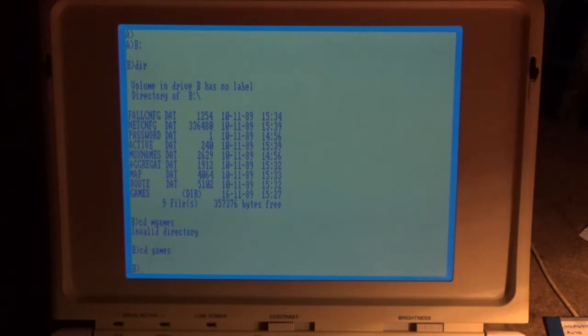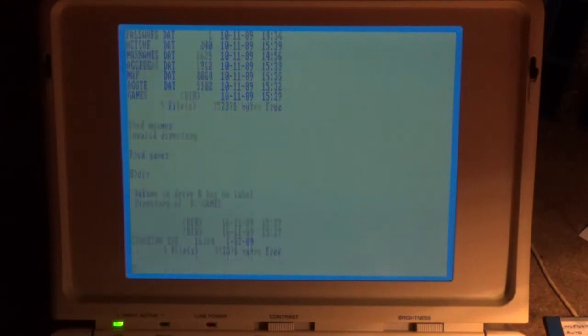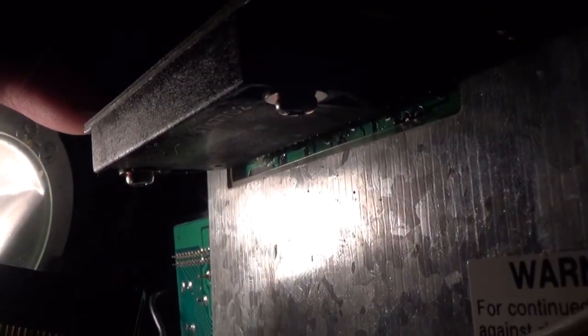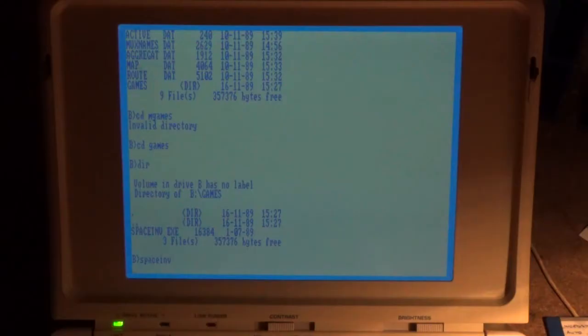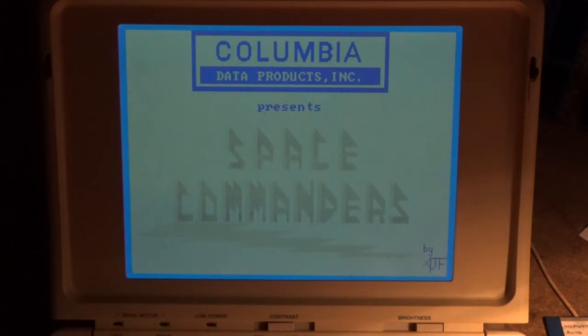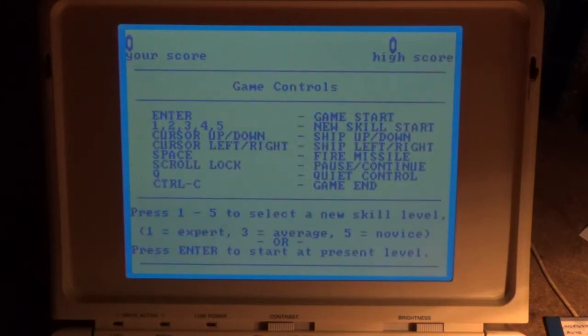Now, the screen is quite slow. It's a passive matrix, though it is good for its time, and it seems to be holding up well in its old age. Still working. It's an STN screen of some kind, twisted nematic, yeah, I don't know. All slow technology, you know, they wouldn't really put these on laptops now. Still, it seems quite a few of these screens have died, so this thing's just kicking ass, because it looks like it just left the factory. The screen's picture, at least. I don't know that failures and such are common on Zenith laptops anyway. They seem to last really well overall. At least in my experience, they just seem to be tough, well made.